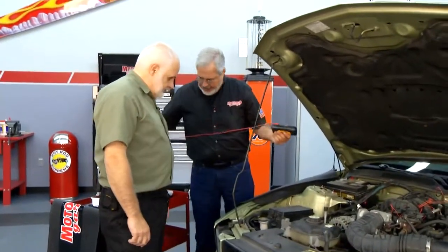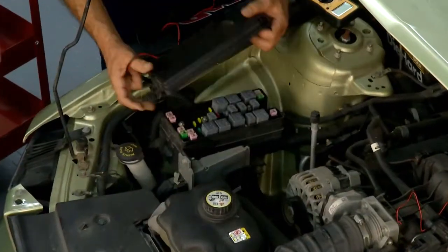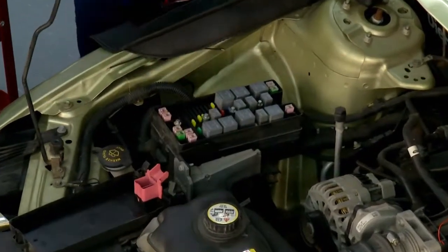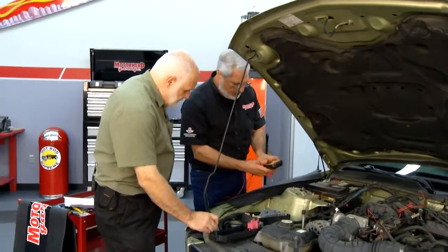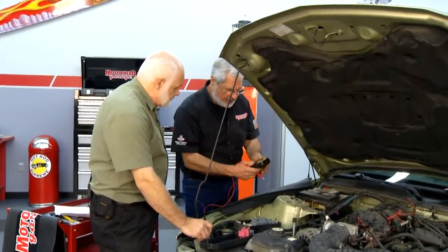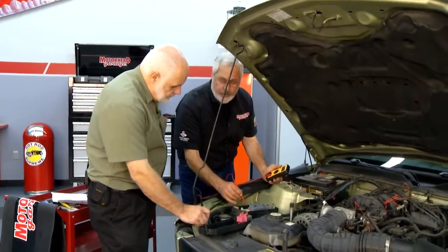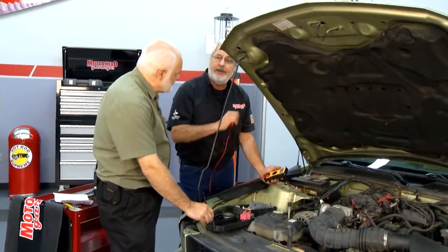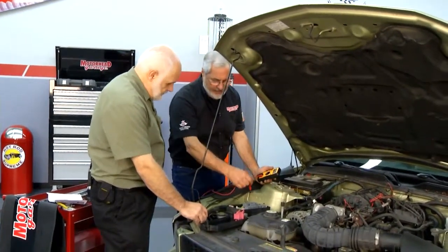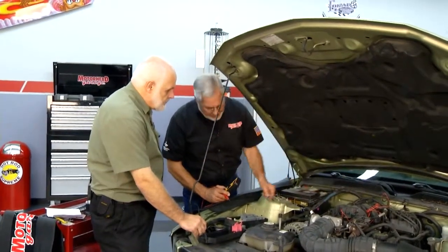What we're going to do is go into the fuse panel, the electrical panel, and probably the one under the hood is the best one to go to. What we need to do is find a switched source. So, Harry, I'll let you be the ground right here. Go to your DC volts. 20-volt scale, make sure you're on DC, okay? And then we'll go across each fuse. We're going to find a fuse that has no battery power with the key off. Dave will turn the key on. I'll find one that's powered. We'll piggyback a red wire that goes this way.